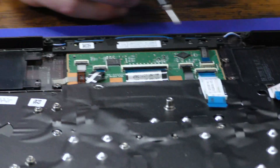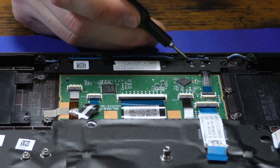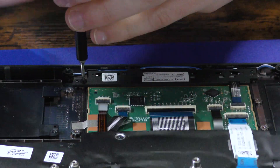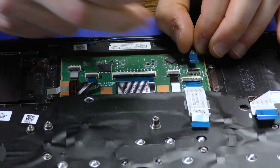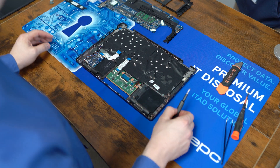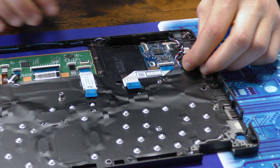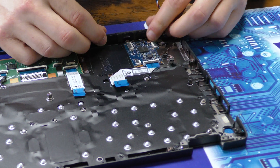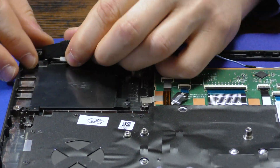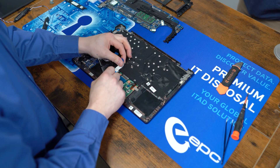We also have the mouse buttons here — they are connected by a small piece of tape to the speaker cables, although I have already cut that piece of tape just for the convenience of the video. That's just held on by this small ribbon cable right here. We also have the speaker assembly here, though that's just held in by these small floating rubber brackets — no screws to get that one out, just a little bit of tape on the cable. We'll also take off these ribbon cables right here just for posterity.